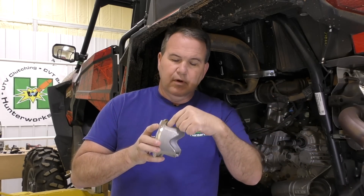Just to run through it quickly: at 50 miles an hour the belt's engaged, everything's lovely. Come down to 10 or 15, the roller rolls in here, slams this shut, brings RPM up, you still have braking. Then it drops out at four or five miles an hour, and if you've got a one-way bearing it drops down and you continue braking. If you've got a two-way, that's when you're going to start freewheeling.